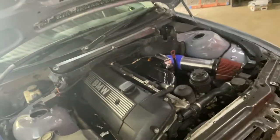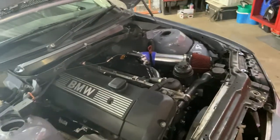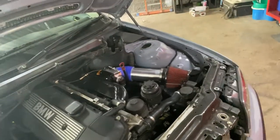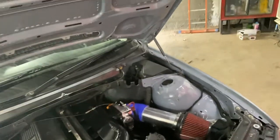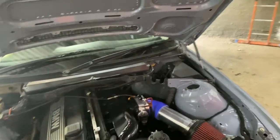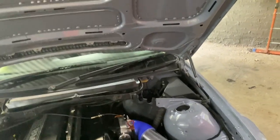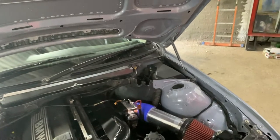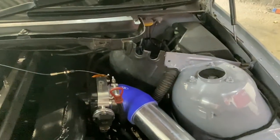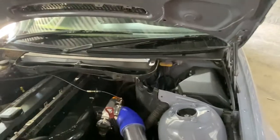Here's my engine bay. As you can see it is an original BMW motor, but it's been played with in a big way. I've got a Viper branch on it with a custom exhaust. The bottom end's been done — it's been oversized so it's just under 3.2 litres. The compression ratio is about 11.7 on the motor, it's got oversized brand new molly pistons, racing bearings, the head's been done, and it's got a custom aluminium intake that's been welded with a 90mm throttle body.